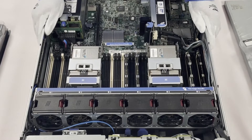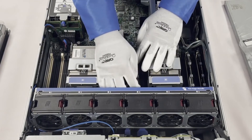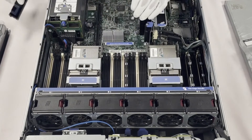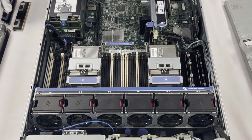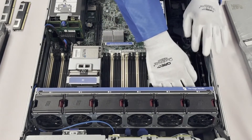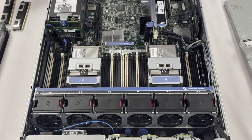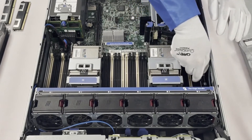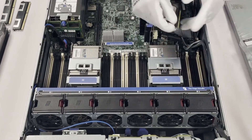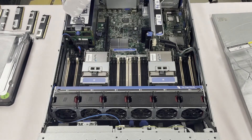Now I'm going to physically show you how to take them out and put them back in. It's very simple — just like any other motherboard. You simply click the tabs and pull the modules out. I always like to put my hand on top because sometimes the modules, when you click the tab, will just go flying up. With a 16-gig or 32-gig module flying out, you could damage the leads if it comes back down and hits wrong.